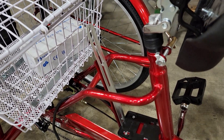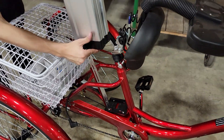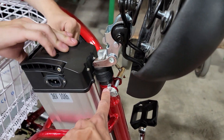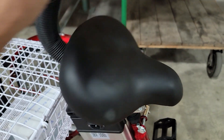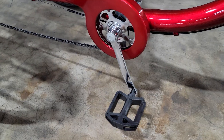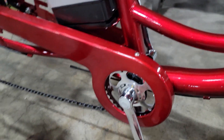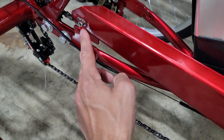Next, it's time to install the battery and the seat. The battery goes like so, and then your seat right here comes up and over your battery. Before we put the pedals on, you want to put on your chain guard first and then you can slide it right through — one screw there, one bolt there.